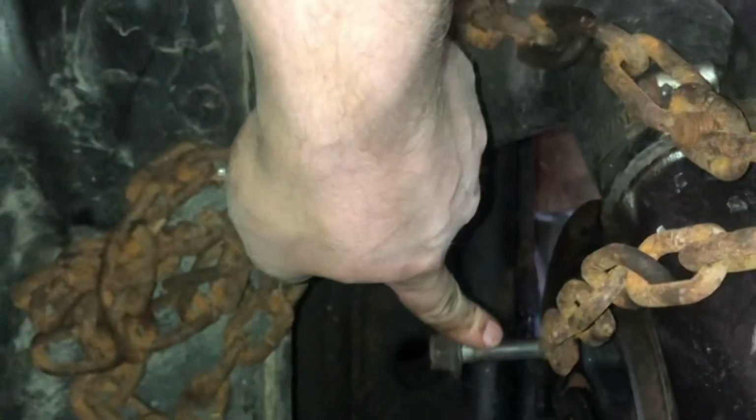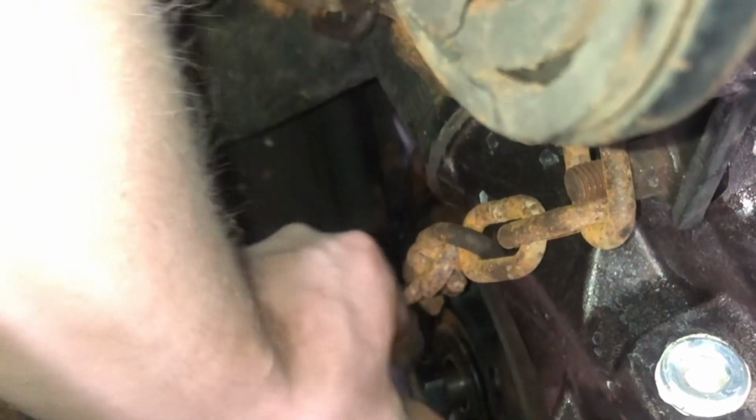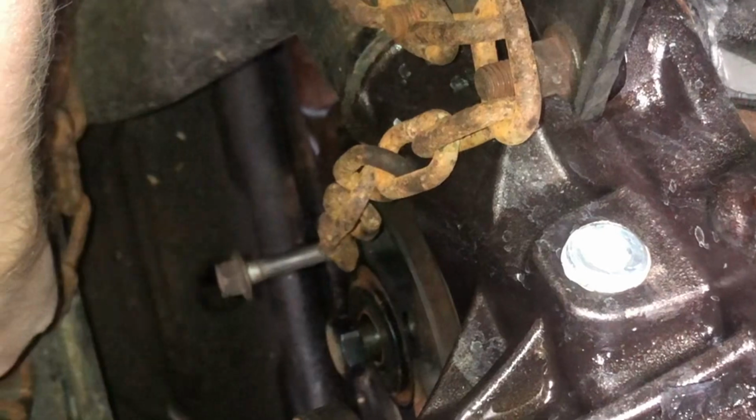All right, so we usually use a choker chain and just wrap it between 2 studs. Use an old harmonic balancer pulley bolt, get down to your harmonic balancer, and you can undo this. They're torqued at almost 200 foot-pounds, so you need something to hold the balancer still. So I'll get this out, pull the old balancer, and do the swap.